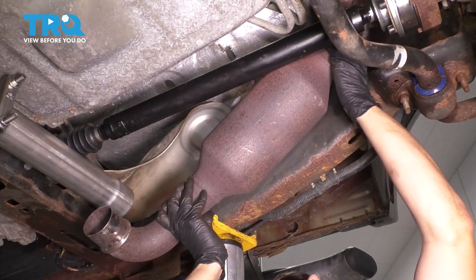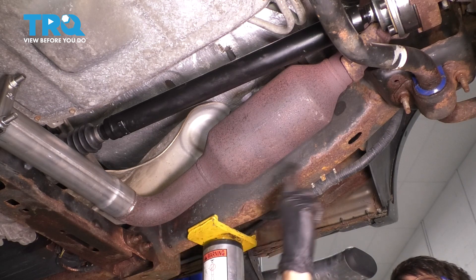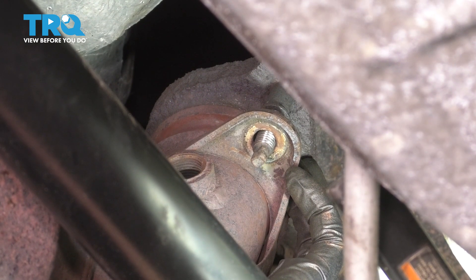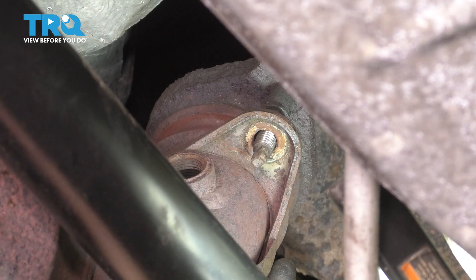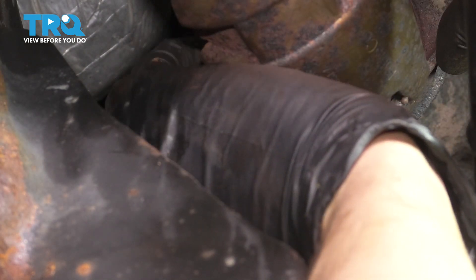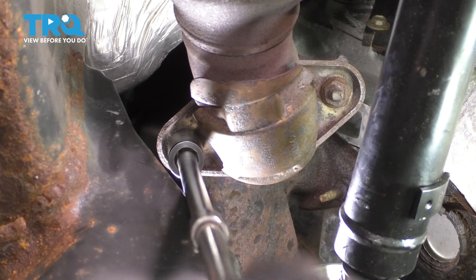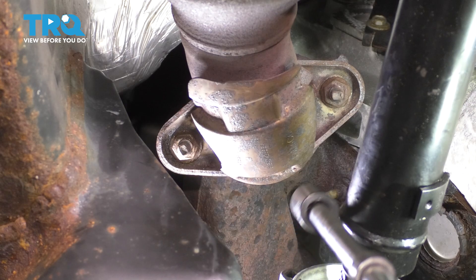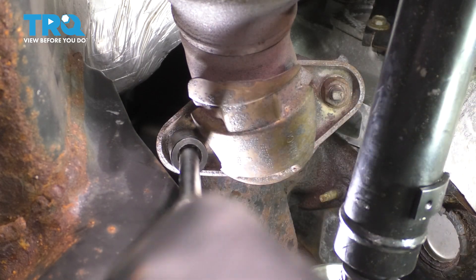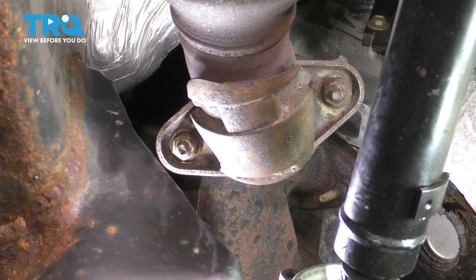Now let's take the driver side pipe, bring it up on the manifold and slide it into the crossover pipe. Let it rest here. Let's get the mounting nuts for the manifold side. You just want to move the pipe around until it fits. If it doesn't want to go over the manifold, pull down on the backside — this will give you a little extra slack. Once it lines up, the flange should automatically line up as well. Start the two mounting nuts. Tighten these going back and forth so they seat properly — it's important that this flange sits evenly so you don't get exhaust leaks. The torque for these two is 30 foot-pounds.